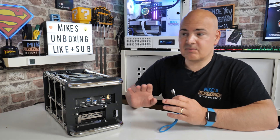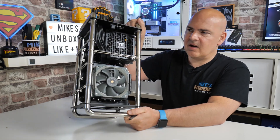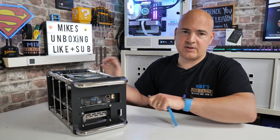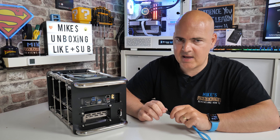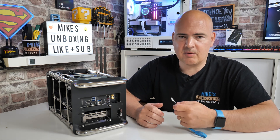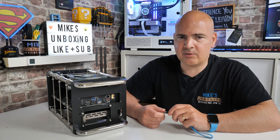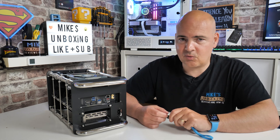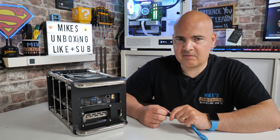Things you're going to need is ideally the motherboard on some sort of open test bench. In this particular instance you can probably see we've got it basically fully assembled. The reason I'm doing this is because the motherboard actually had basically one of the first BIOS releases - I think it was F3 - and we want to install Windows 11, so we need to enable things like TPM, secure boot, etc. And also it's always worth having the latest BIOS on your system before you start installing Windows. At the moment we basically can't install Windows 11 because it just won't do it - it isn't supported.